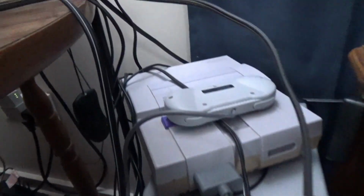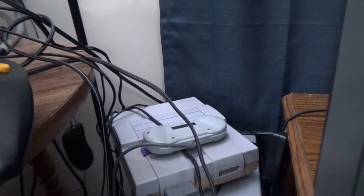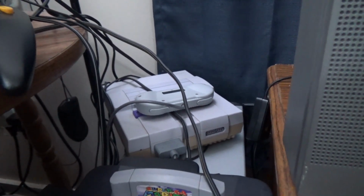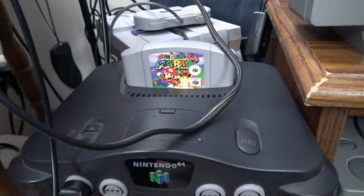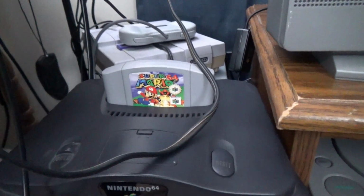Anyways, if you use the Super Nintendo's RF switch, that basically will convert everything over to mixed mono, so the channels will be mixed together. But wow, there was an official RF modulator for the N64, and I never had it. I never got to use it, and so on games where you couldn't change between stereo and mono, if there were any, the experience was degraded.